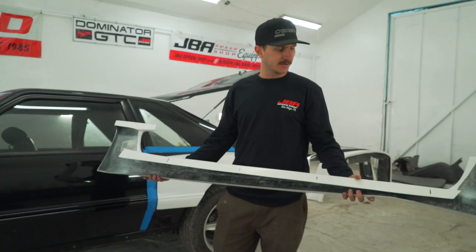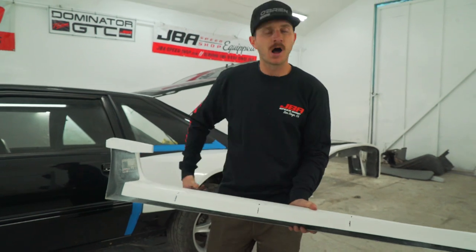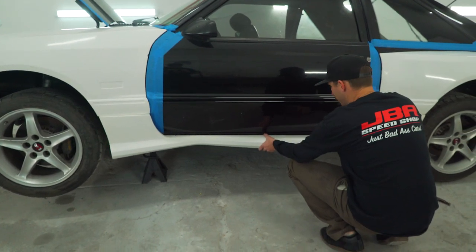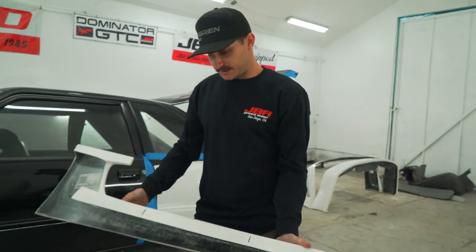Here we have the side skirt again off the driver's side. As you can see, we have it marked here with black Sharpie on the four holes for the nut certs. And that was the reason for leaving the black Sharpie line on the top side, so you can see where the nut cert is and it's easier for marking. So we'll get going on these and Dremel these out and leave them slotted to make it a little easier